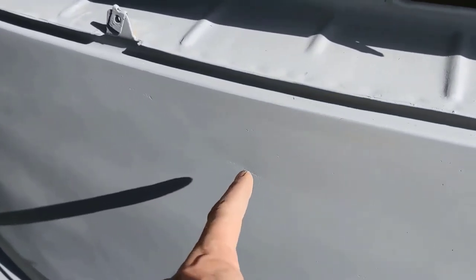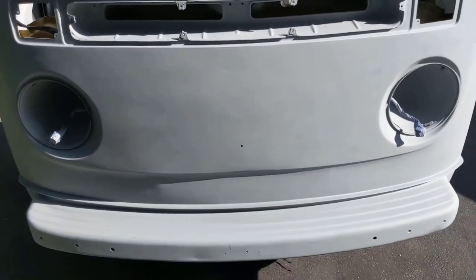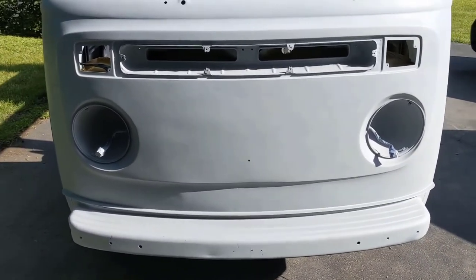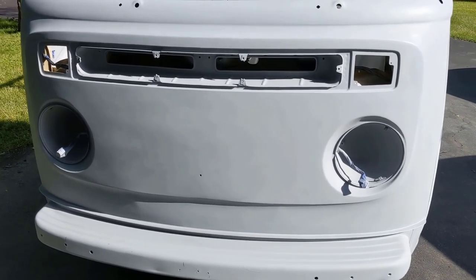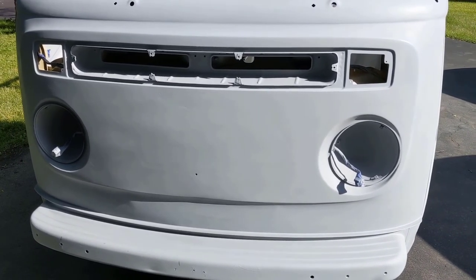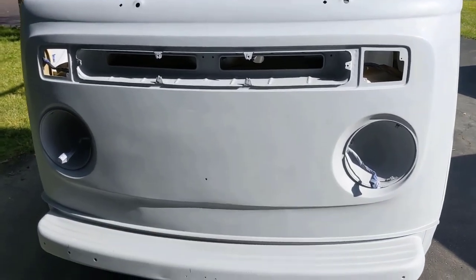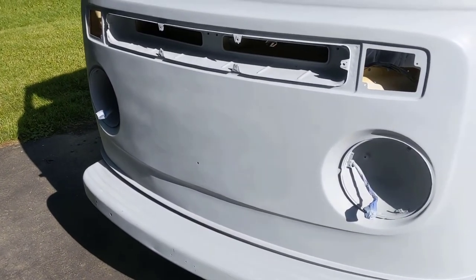You can see there's a little bit of feathering I didn't do there, a little bit of stuff there, some pinholes. Maybe I might go over this with high-build primer and do the sanding at 320, and then the epoxy primer after that. So there's still a little bit more rounds of fill to go with regard to the priming.